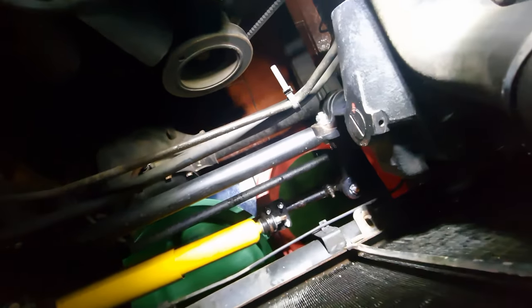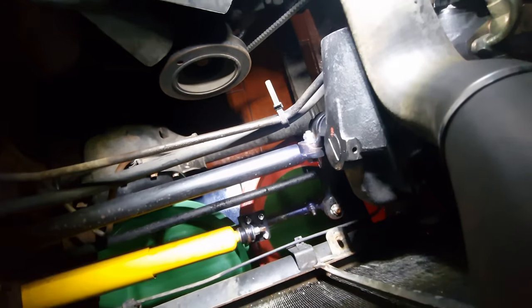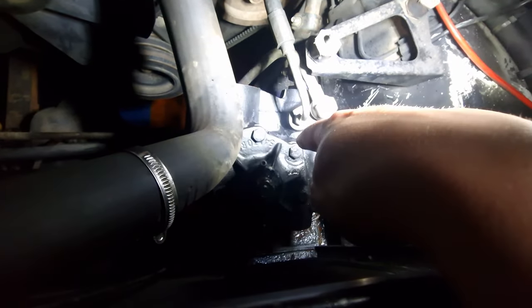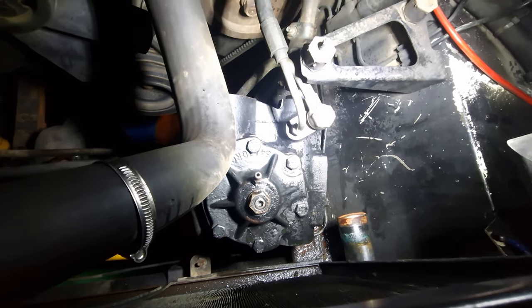What happens is that this whole thing was fixed, you know? The whole pump was dismounted and all refurbished. So all that leverage that it used to have, because of wear and tear, all those gaps, it doesn't have anymore. So it's so tight now that it's starting to show more bending on the hydraulic steering pump. And because the tires are a bit bigger than what they were, I think this isn't a good manufacturing system. The way it was manufactured wasn't very smart, so there was a fail there, you know. So what we're doing is trying to improve what was badly done from factory.